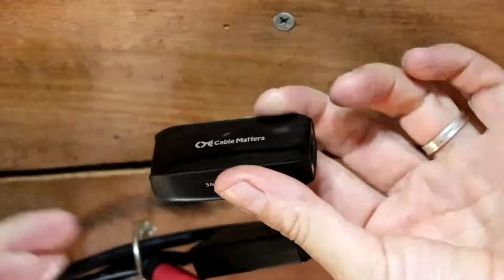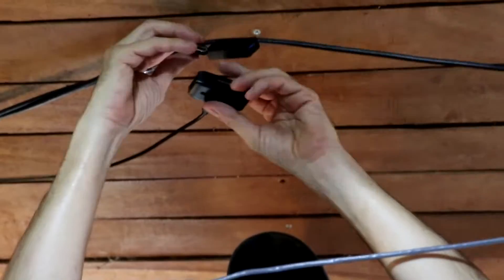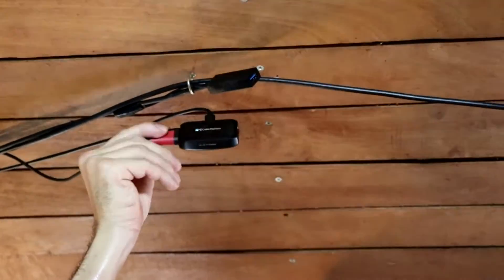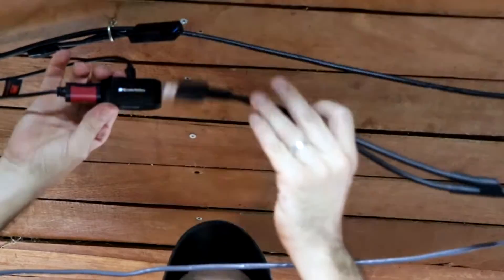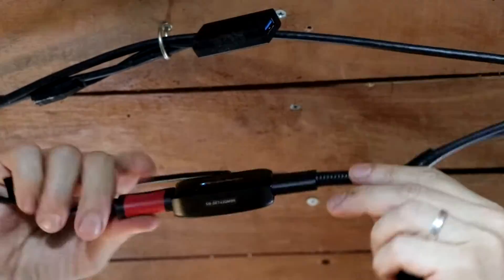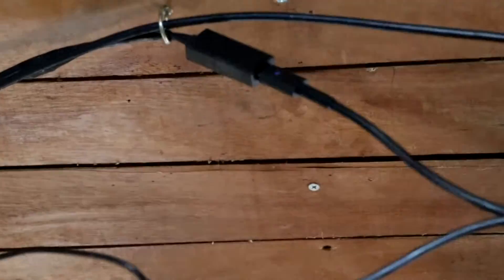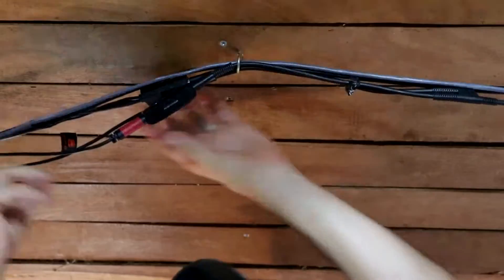The first thing I want to do is bring power to that HDMI repeater. We're going to take the 15-foot mini-USB power cable and plug that directly into that repeater — now our repeater has power. Then I'm going to take that HDMI cable, plug that into the input side, then take my Oculus Rift cable and plug the HDMI cable from the Oculus Rift into the output side. That's the setup for the HDMI section. The last thing we need to do is plug in the USB cable from the Oculus Rift into the USB 3.0 cable that we just added — and that is our complete setup.